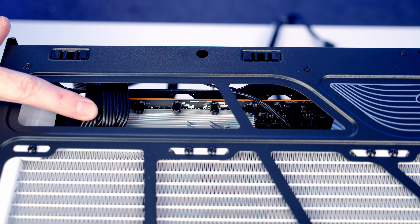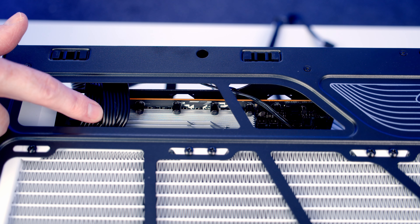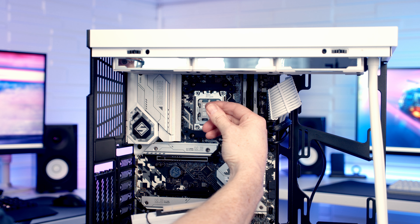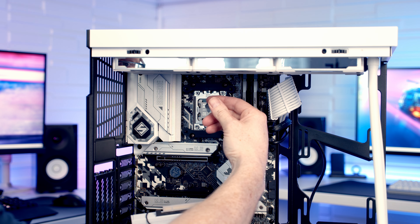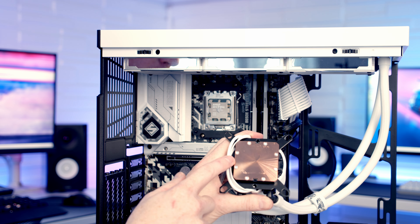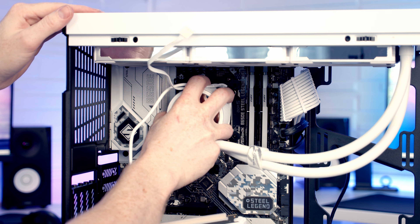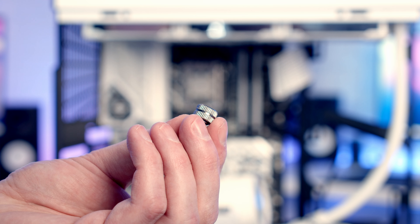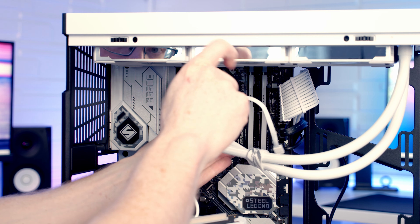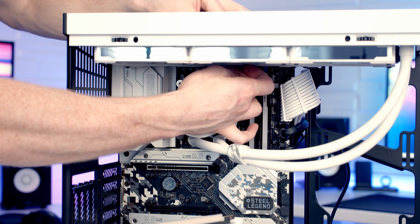You can see how this little cutout works at the top — you do have access to the top of the motherboard to plug things in, although it makes sense to plug them in before installing the radiator if possible. We can then pass the cable coming from our Lian Li Uni fans through to the back. I'm then going to add some thermal paste to the centre of the CPU — if you get the cooler from new it will have thermal paste pre-applied. Take a look at the CPU cooler and notice how I'm routing the cables from the bottom just around the side of the cold plate up to the top to help organise them. We can then line the pump up with the bracket we've already installed.